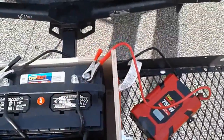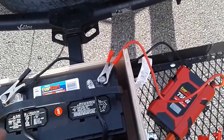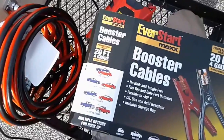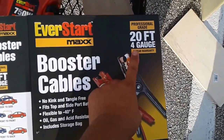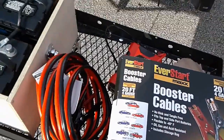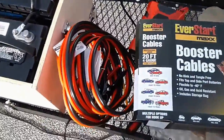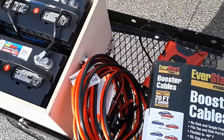She's got a bank here showing 12.6, and this inverter is actually going to be transferred inside the van. But for now we're just testing it, and I'm going to run cabling in so we can have power inside. The second thing to do is run a cable from her alternator — or the vehicle battery — back here so it can charge the system. We're going to take a lesson learned from my experience with Little Blue 2: I used 10-gauge wire before, but we're going with 4-gauge on hers, which is thicker, so that electricity can flow better especially running from the back of the vehicle all the way up to the front.